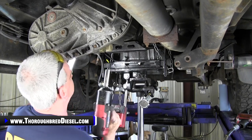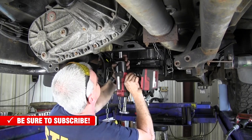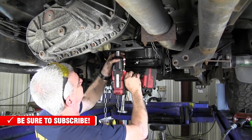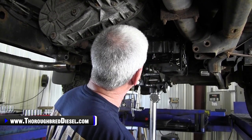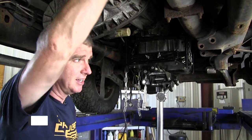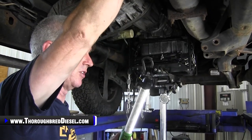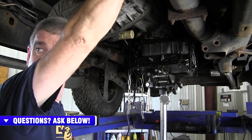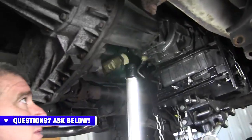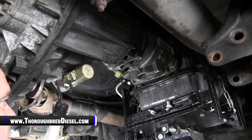We're going to remove the isolator bracket — there are four 16 metric bolts on this too in the transmission. Removing this gives us access to that bottom nut on the transfer case. My preferred method is to take the transfer case off before taking the transmission out — you've got more leverage to work on the transfer case with it in the truck attached to the transmission, and I don't need an extra man on the jack helping me balance. Today it's not going to happen that way. Common rail Dodges seem to pull up a little bit of rust and this thing just doesn't want to separate, so I'm going to have to have this on the ground for some gentle persuasion. We're going to drop the transmission with the transfer case attached.